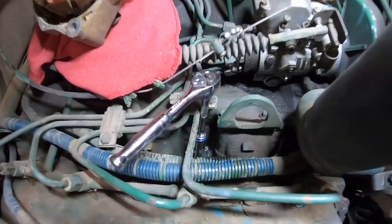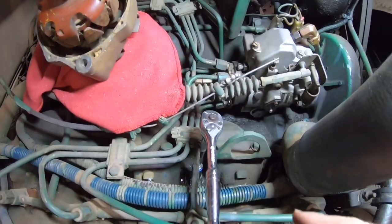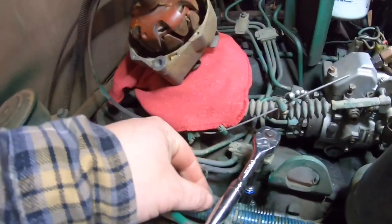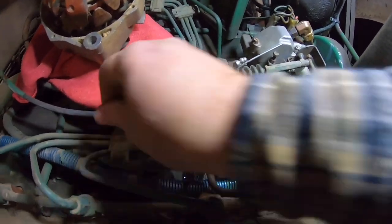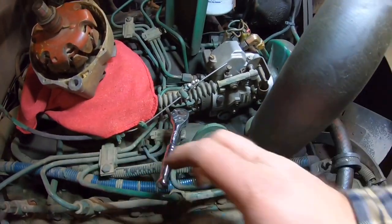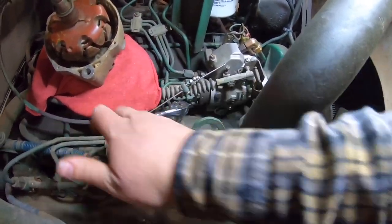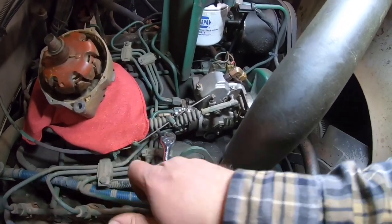You'll need a quarter-inch drive ratchet and a 10 millimeter socket - actually three-eighths is what you need, I just didn't have one. Of course you've got to unhook the wiring first; it has a little clip you have to squeeze to release. You can't use a three-eighths drive extension - it's too fat, it won't fit down in there and let your socket line up without moving the injector lines. A quarter-inch drive works, and if anybody had a little swivel socket it would help a whole lot.